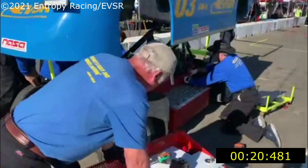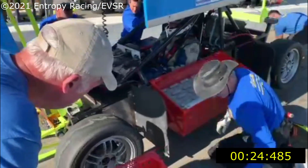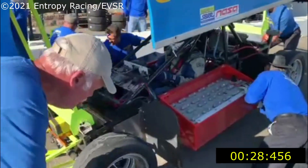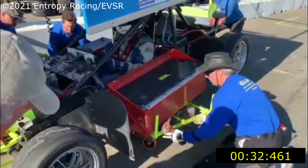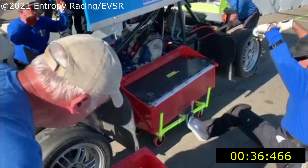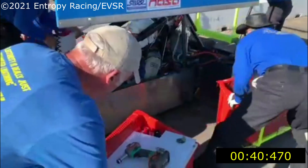Backing out the bolts on the battery packs, jack the car up — the battery packs hook over the side rails of the chassis. Roll a dolly underneath, cover the battery so the terminals are safe from any electrical contact. Lower the car, batteries come off onto the dollies, rolling the new dolly.